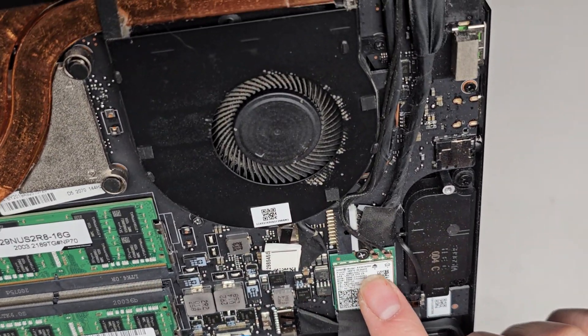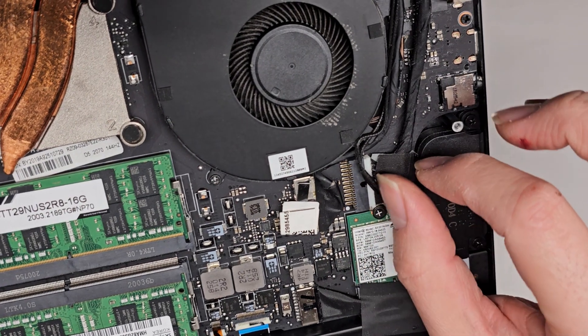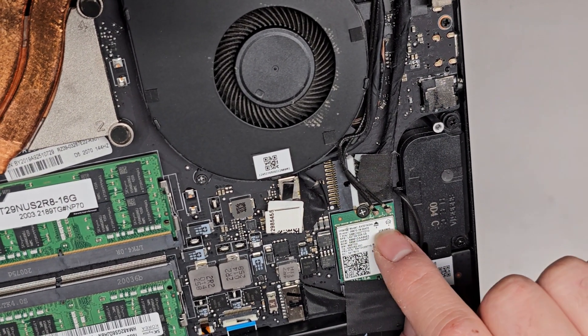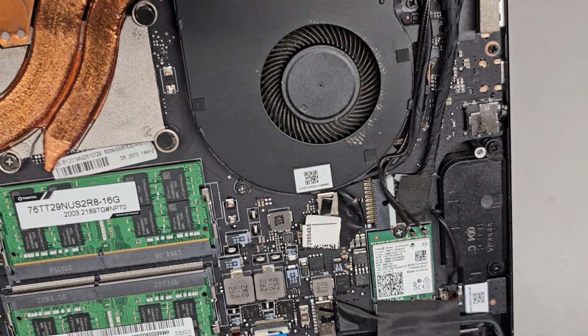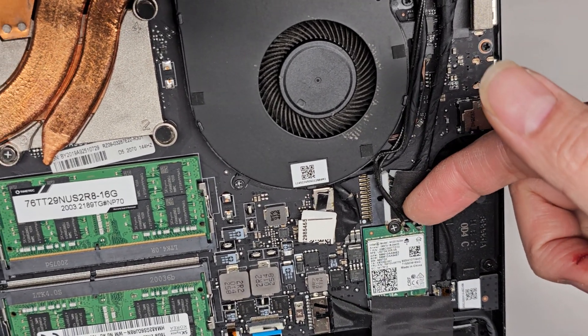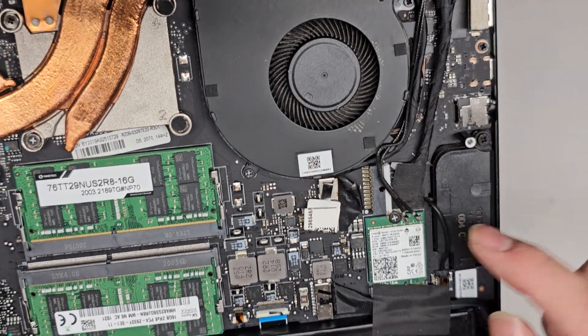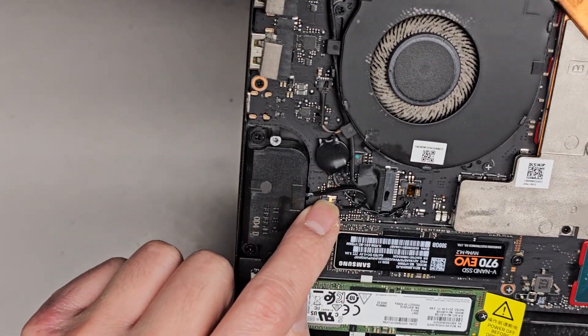The wireless card is here. There's black tape around one of the antennas going to the white arrow, and then the black arrow doesn't have that — I don't know if yours will be the same. If you want to remove the antennas, you go from the tail — usually I just get my fingernail underneath and then pull straight up. You got the speaker connection for this speaker here, and the other speaker connected here.